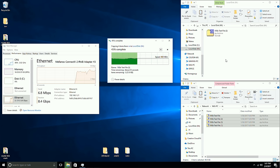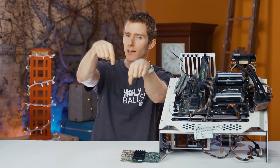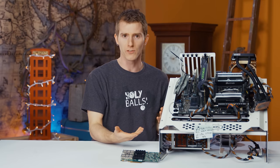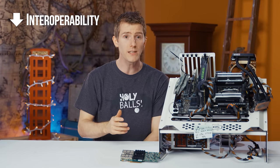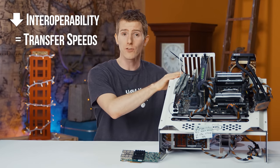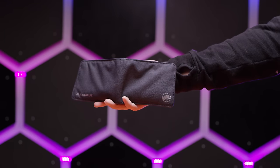So what gives? The answer is RDMA. On Windows Server or Linux we could expect much better — perhaps a follow-up later? Let us know in the comments if you'd like to see that. Either way, we're pleased as punch with the results, because compared to 10 gigabit Ethernet, we do lose the interoperability with other Ethernet gear, but we gain the same transfer speeds as long as all we're looking for is point to point, and a whole lot of money back in our wallets.